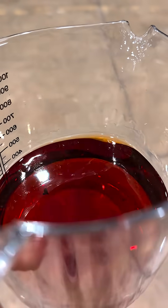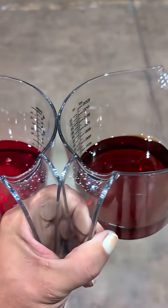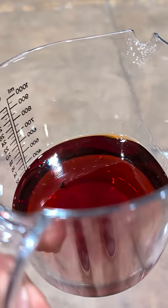This fluid has been to 500 degrees, and this fluid is new. You can see how much color cooks out of it. So if your transmission fluid comes out brown or clear, it's been very hot.